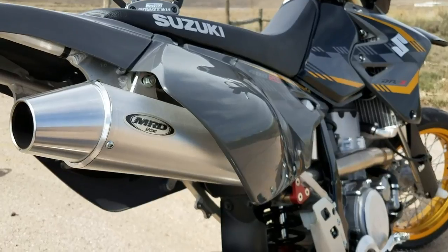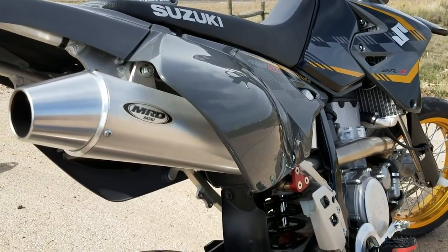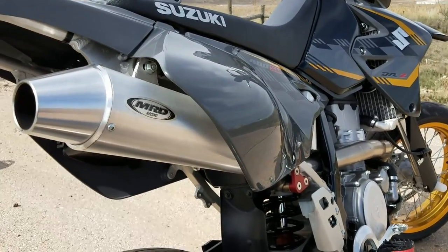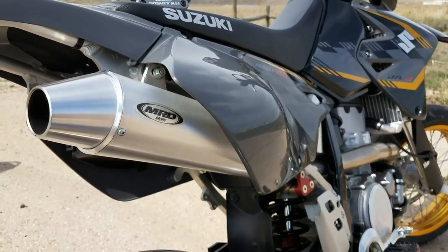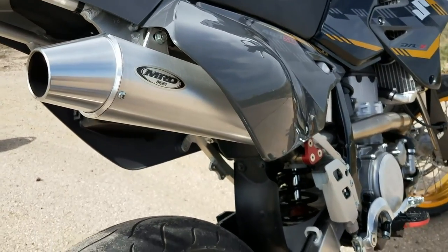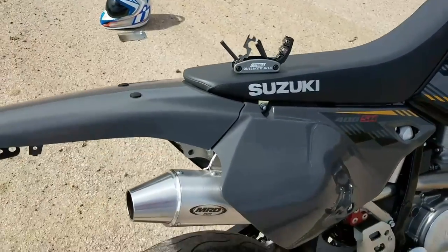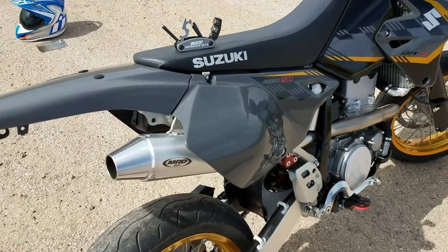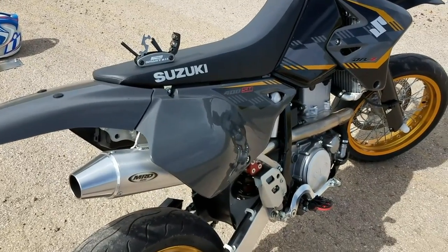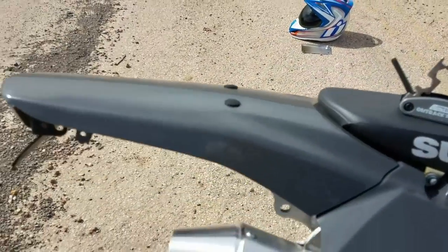If you want a forest approved one that's actually stamped, Yoshimura or FMF probably is your way to go. This exhaust is about 6.5 pounds with the spark arrestor. The stock one with the heat shield was about 11.25 pounds. So remove some weight, gain some power. Looks a lot better too. And there's a guy on YouTube called Tyler. I'll put his link in the description. He does a really good comparison video on it, so if you guys want to hear what it sounds like.